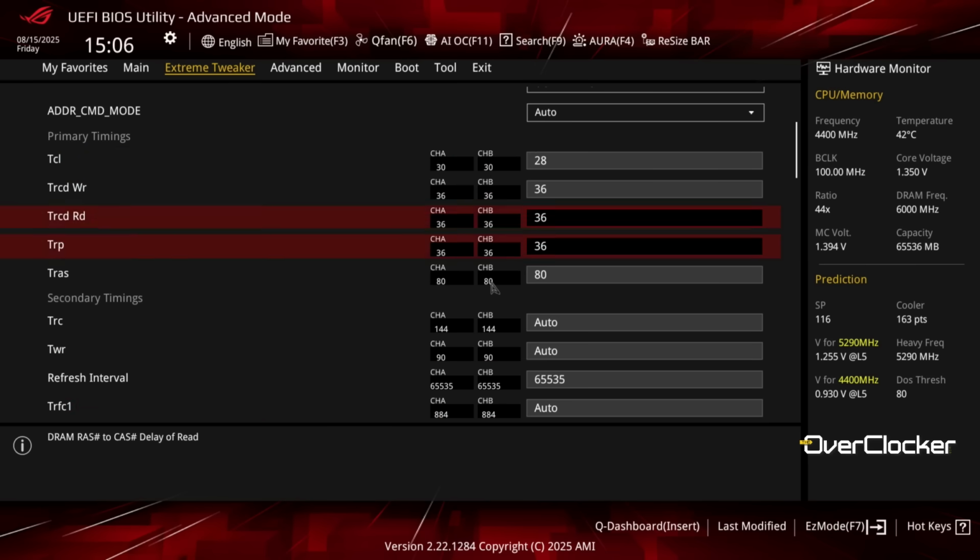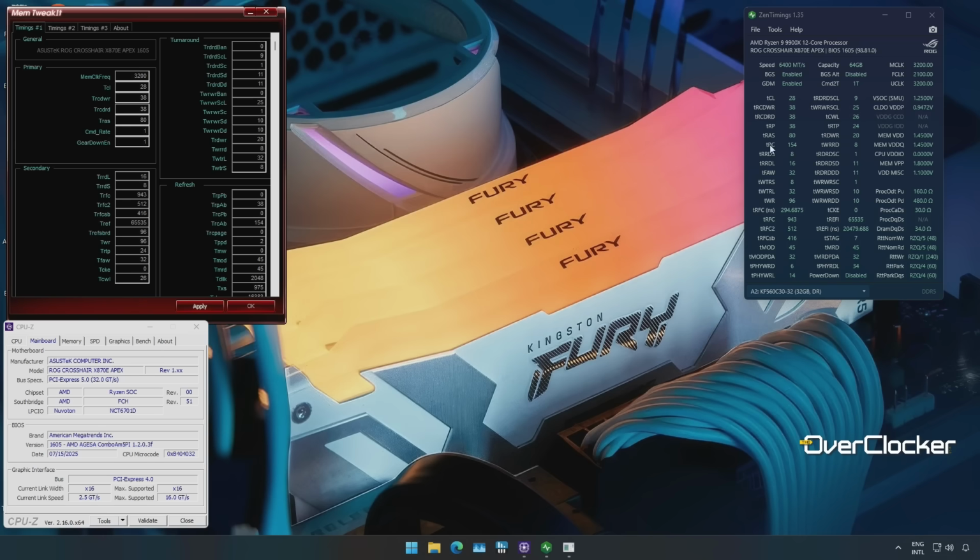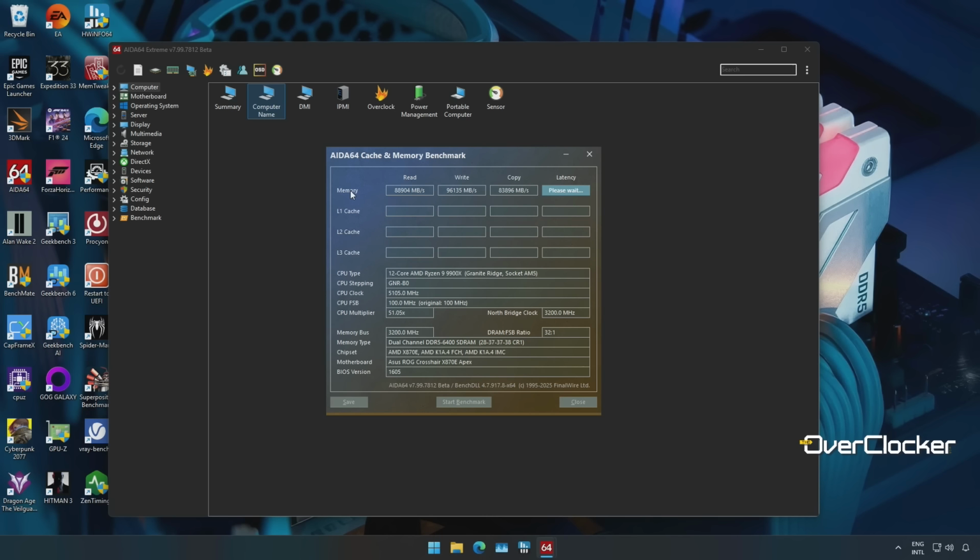The best I could do reliably and with stability is DDR5 6400, which is still good, especially for AMD. Not all is lost though, because dual rank kits are faster than the single rank counterparts, and as such, a 32GB DDR5 7000 kit is actually slower than a dual rank 64GB kit operating at 6400. While the frequency wasn't there, the nature of the memory access on dual rank kits allows effectively more performance than I'd get at a higher frequency on a single rank kit.